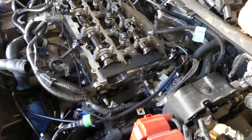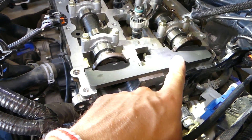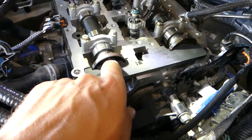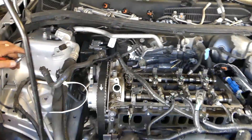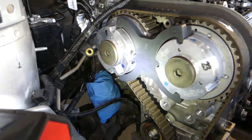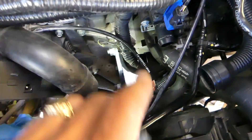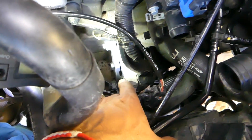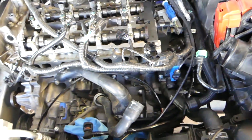Right here we have the locking plate for the camshafts; it goes in on the back side, holding each of them. On the front, this plate holds the clutches. We also have the flywheel holder installed where the starter usually sits, holding the flywheel in place. All the individual steps are covered in separate videos on the channel.